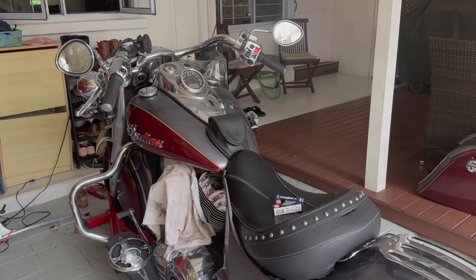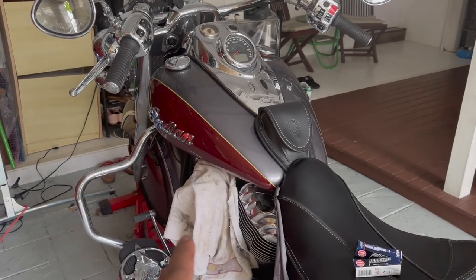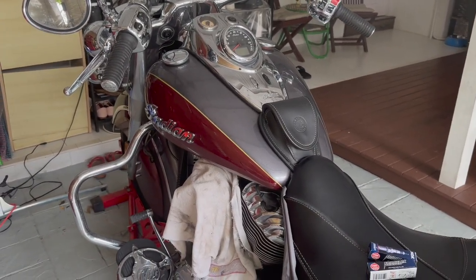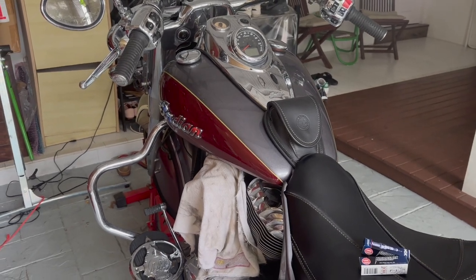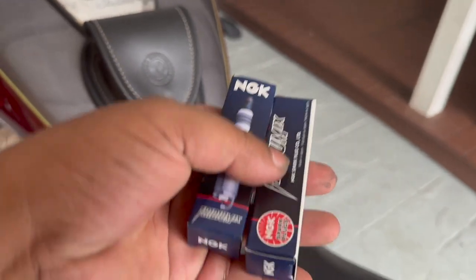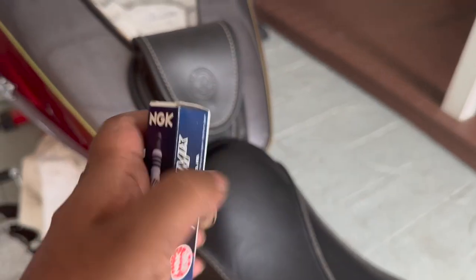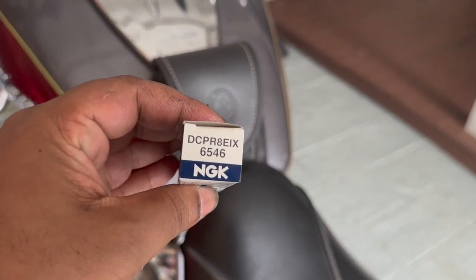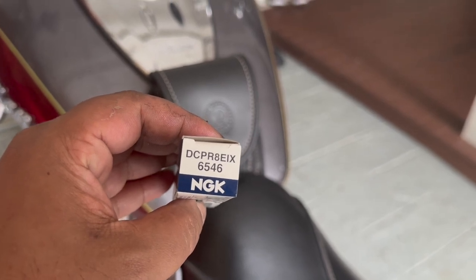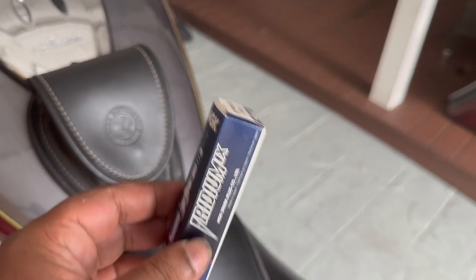So let's move to the bike. I've removed the air filter because I'm just cleaning it - it's good to do that every so often or every service. But I'm going to get to the spark plug change and gap. I've got these spark plugs from NGK - these are iridium spark plugs. The part number is DCPR8EIX, where IX denotes the iridium type. I'll put a link in the description of where you can buy them, but you can probably get them on Amazon or eBay.